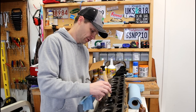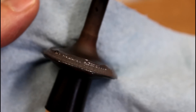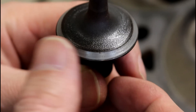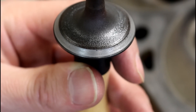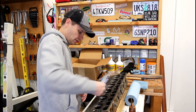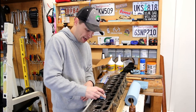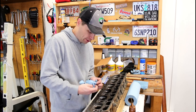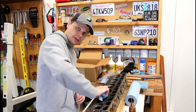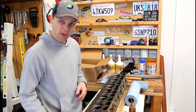All right, I think that's enough with the coarse grit. Let's take it out and see what we've got and make sure all that pitting is gone. Oh yeah, much better. So let's hit it with some of that fine grinding compound and polish it up. When I'm all finished with this I'm going to take the head and all the valves and give them a good bath — a good washing with soap and water — to make sure I get all the little bits of compound out, because you don't want any of this residual stuff left over in there causing problems with your engine.